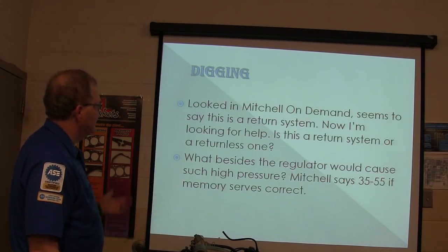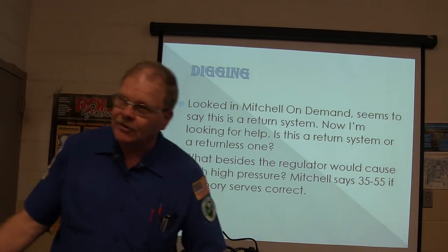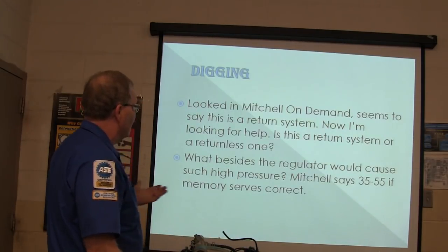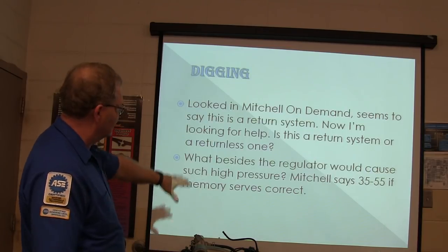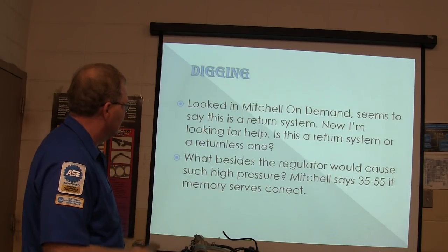Didn't find anything. Looked in Mitchell On Demand. Seems to say this is a return system. Did that surprise you? All right. Now I'm looking for help. Is this a return system or a returnless one? What besides the regulator would cause such high pressure? Mitchell says 35 to 55, if memory serves correct.